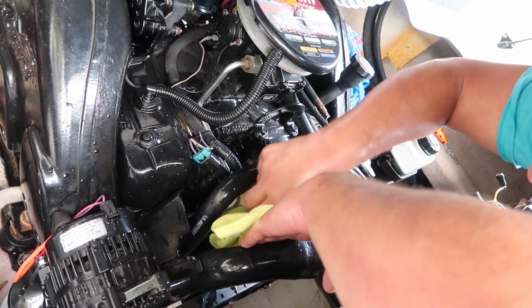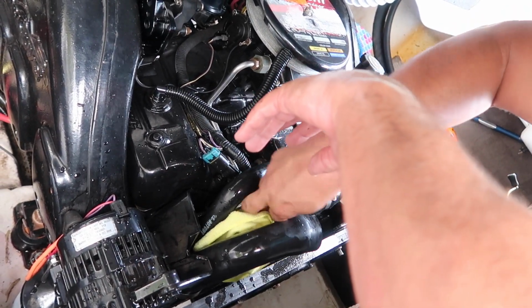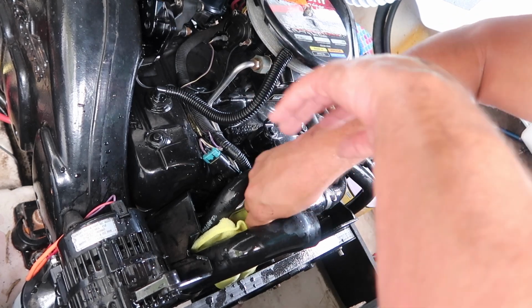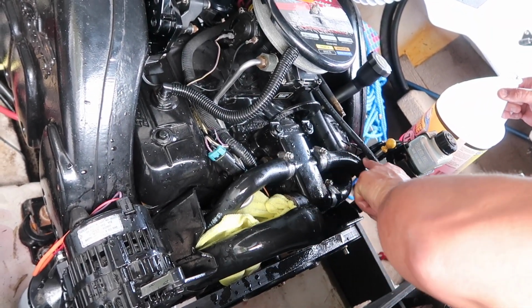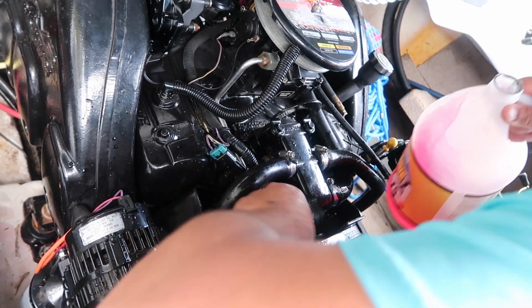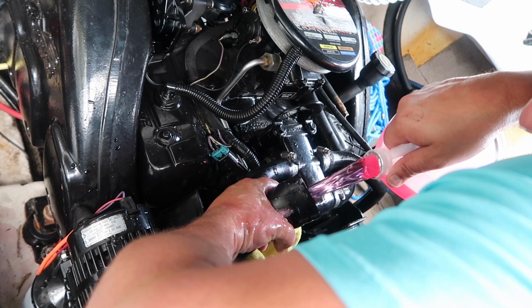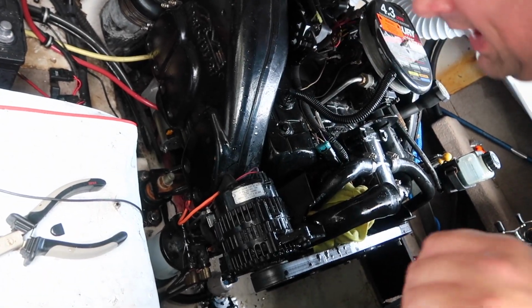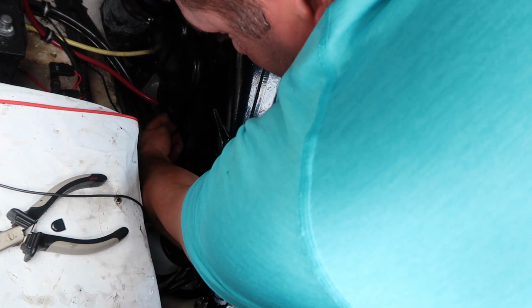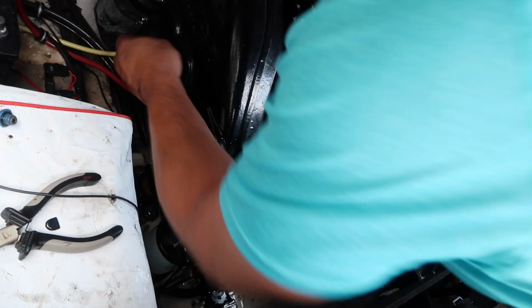What I'm gonna do is put a towel in here and make sure you don't probably have to do this. That way it won't come out of here, and I guarantee the coolant's gonna go in through here. So what I'm gonna do now is drain the manifold again and make sure that everything got filled up properly. Completely pink. Try the block now.